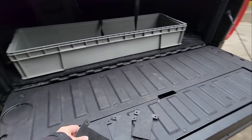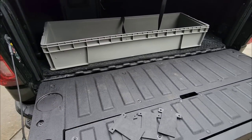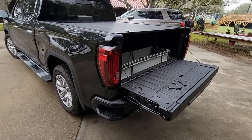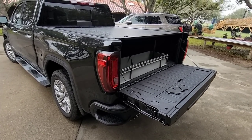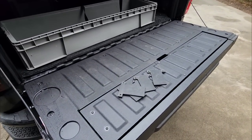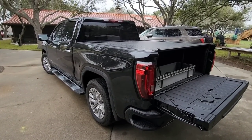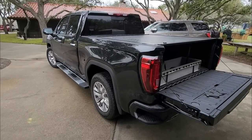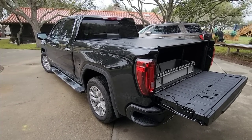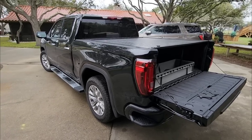This is essentially a knockoff of that product — quarter inch thick rubber with some holes on the end where zip ties are going to go through. I have my own zip ties, so we'll see if these work. Hopefully they do. If they don't, I might actually buy the ones specifically designed for this. The first step is to lift the suspension off the ground so I don't have any tension on the springs, so I can space them and fit the bushings in between the top two leaves.